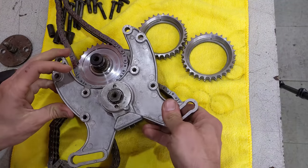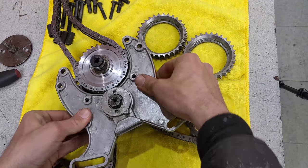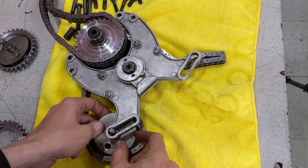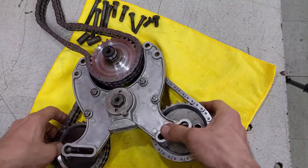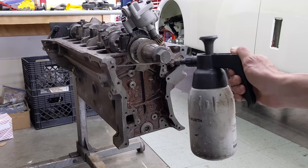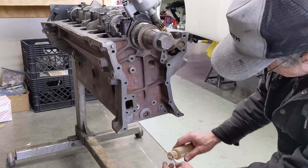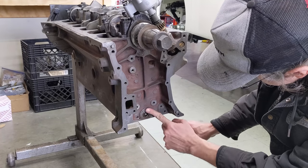Take the other half of the assembly and drop it down on top. Make sure everything's lined up. A little finicky. Then put the camshaft sprockets in place — this is kind of a fussy job. There we are. Just going to give this one last little wash in here — always want to be really clean when building motors and engines. Let that dry out. The intermediary sprocket gear has a bit of a dowel area, so I'm going to put some lube to help it out initially, because you have to run the engine for quite some time before this area gets lubed.